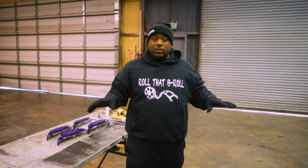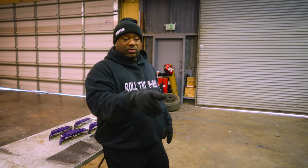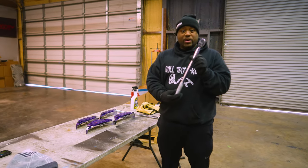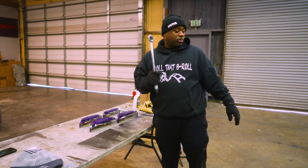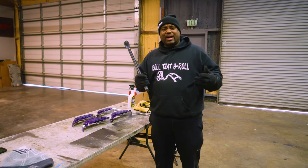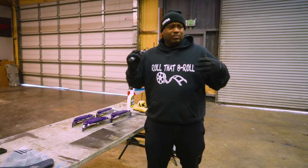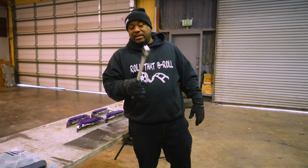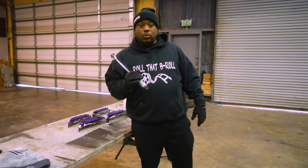So without me further talking along, we're finna get one of these wheels off. This is what you're gonna need. So you're gonna need a torque wrench for the end so you can torque your rims back to the specs. I know a lot of people out there, they put their wheels back on and they just tighten them. Everything on a car has specs. So I'm torquing these tires down to 120